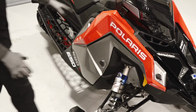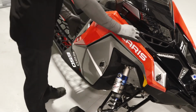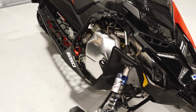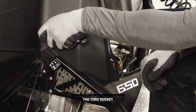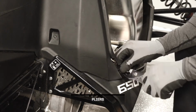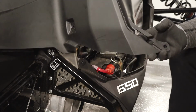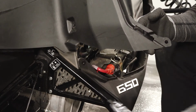To drain the fluid using the front cover method, remove the right side panel by turning the 3/4 turn latches. Pivot the panel away from the sled and pull out to remove. Next, remove the fastener on the lower right side of the console. Then remove the push rivet securing the lower right portion of the console. Continue by removing the push rivet underneath, securing the right fender to the footrest.